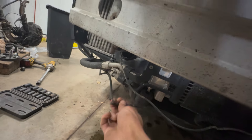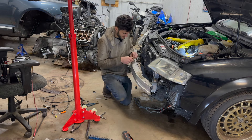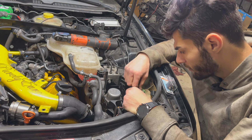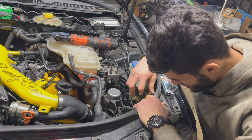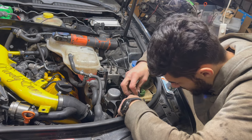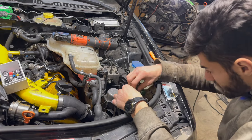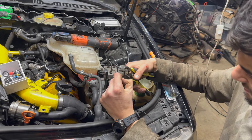This wire over here is ripped, likely from the car being so low, so the fans weren't working in the first place. But before I do any of that, I should check whether these fans work at all. The most common way of wiring the electric fan switch is to tap into the brown and green wire on pin seven of this connector, which has something to do with the cooling temperature switch. This will cause the fans to activate whenever the AC is on, which I'm okay with. This is going to be our signal wire.